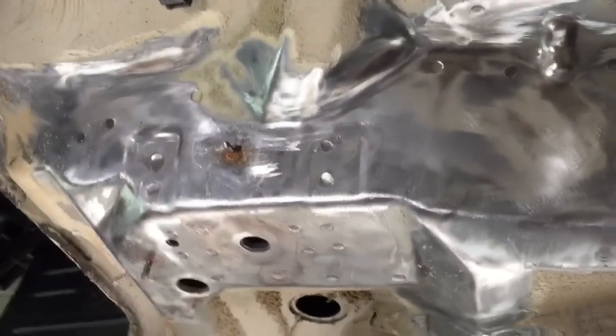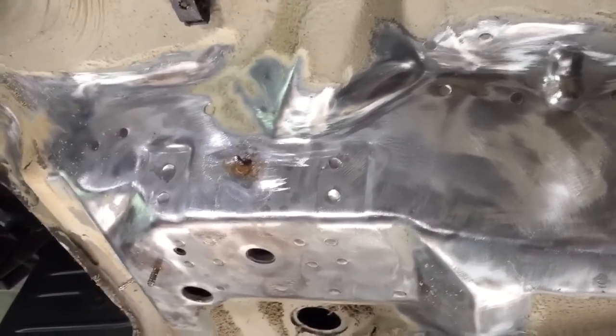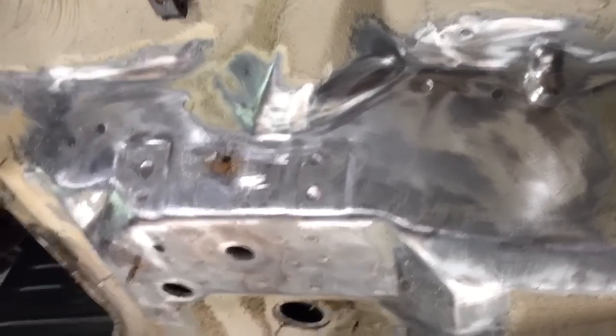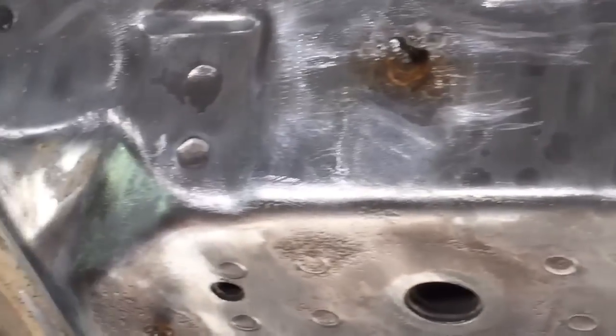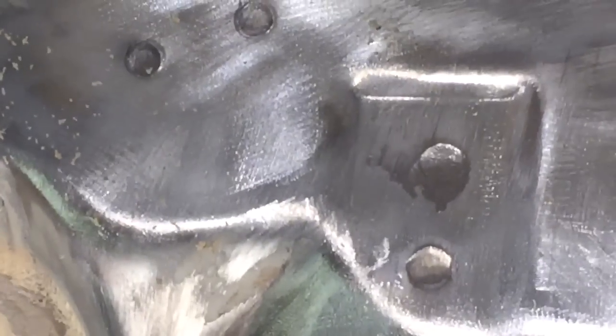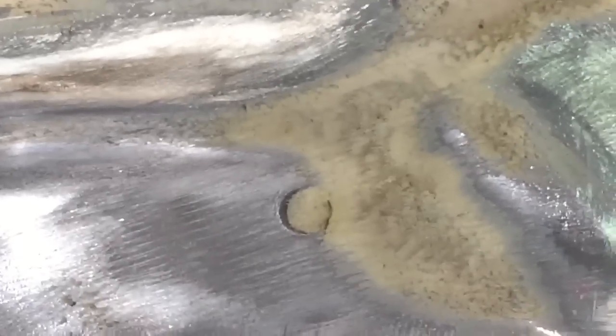pre-grinding. So working on this right rear one, this is ultimately the hardest one because the cracks are so minute on this side. Normally they're secondary ones compared to the left rear side that they take ages to find. So I think we've got something in the corner there, which we're gonna have to heat the panel to see. We think we've also got something tracing up here because there was a direct line underneath the sealer. We've got a definite crack around the outside of that spot weld up there, which is going into the boot cavity, the hidden cavity. And also we might have a crack in this corner as well.